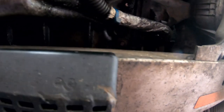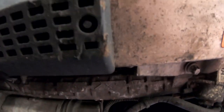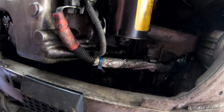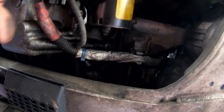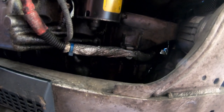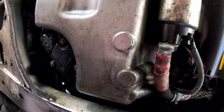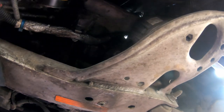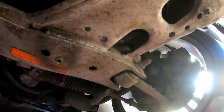Once we've done that we'll have to try and lift the engine so it comes off the mountings. In the absence of my engine crane — I've lent it to a friend who's pulling an engine on his car — I will, using a big chunky block of wood, just lift it gently on the bottom of the sump, or probably better on the rim of the gearbox. If I lift it on the rim of the gearbox there won't be too many dramas and we should manage fine. So I'll start cracking those bolts off.